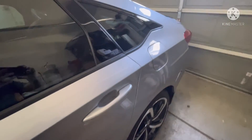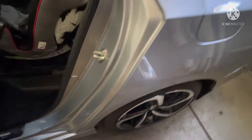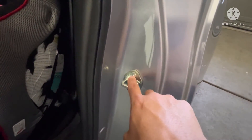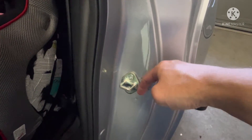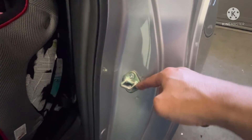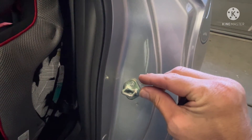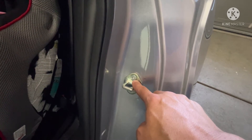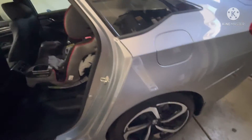But this gap right here — some people said it's way too high. I see some TLXs that come out of the factory just too high. Well, it's the same way to adjust it. All you do is loosen these screws just enough so you can slowly slide it down. What I would do is loosen them a little and take a screwdriver and just tap on the top here to slowly drive it down.